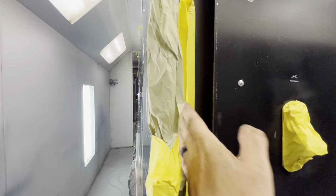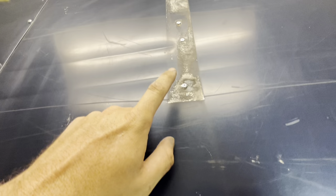Tail lights, could have taken out, actually no, they're double-sided taped on. I think the foam backing is double-sided taped on, so we don't want to take them out. The holes in the trailer, I was going to use seam sealer, but it didn't look good, so I just put some rivets in it to fill in the holes. So we'll paint over it. Hopefully the rivets will look just like everything else. Missing a screw there. We're going to have to go back through and probably put a couple screws in and dab the screw heads and match.